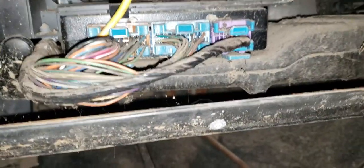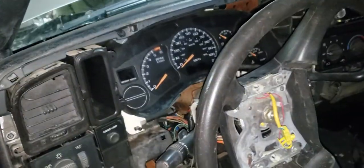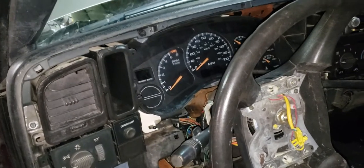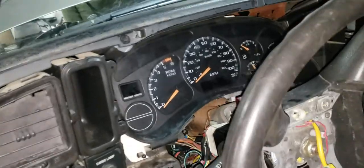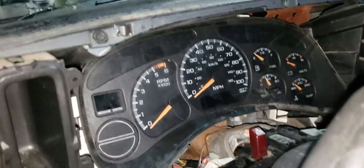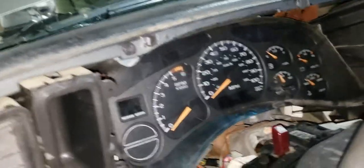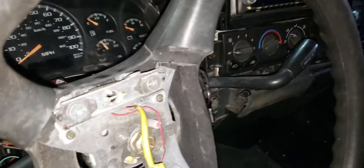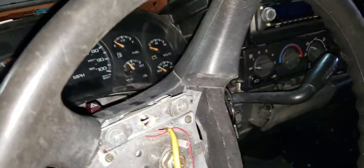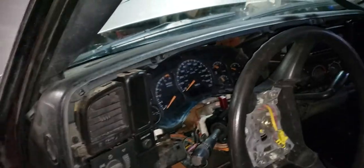After those three cycles, you'll be able to start it. Then you can come down here and unplug your BCM — and that will save you about fifty or sixty bucks, whatever they'd charge to disable it. I'd still recommend getting a tune eventually, especially if you're doing cam or exhaust work, but this is a quick budget way to disable VATS and get your project running.